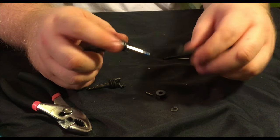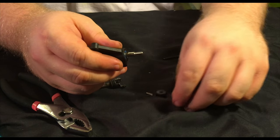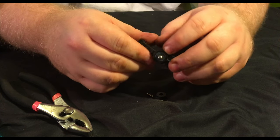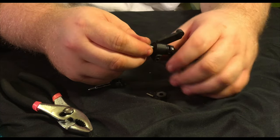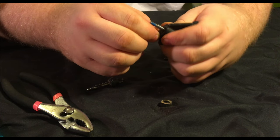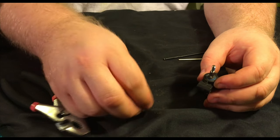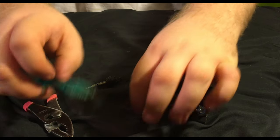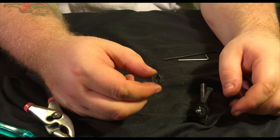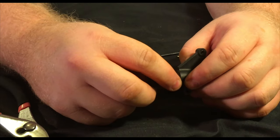Take your new part out of the bag and slide it in between the two bearings in the bearing carrier. Once you get it through, take your little washer, put that on first, then take your pin and slide it right in where it came out — that pin keeps the hex on. When you take the hex, you'll notice a little groove on the inside; that's where the pin goes. Clean it off first, then match up the groove with the pin and slide it right back on.